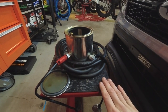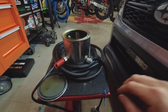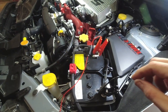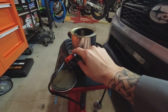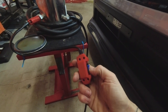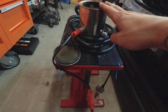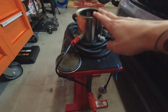It's a basic setup. You want to set it on something solid and heat resistant, as this thing gets hot really fast — you don't want to put it on any plastic bits on your car or anything that might melt. As far as the electrical setup goes, you've got your negative terminal and positive terminal connected. You run it down to the connector on the back and screw it on nice and tight. The way you can tell you've got good power is it lights up blue. It says 15 minute max cycle, and it usually takes about five minutes to get hot enough to generate smoke.